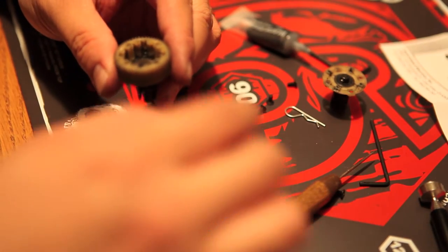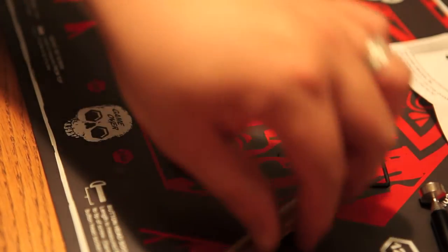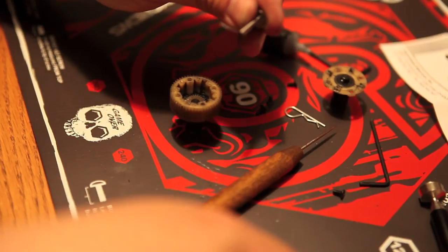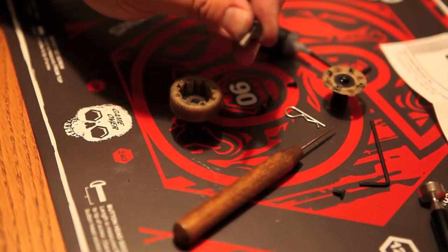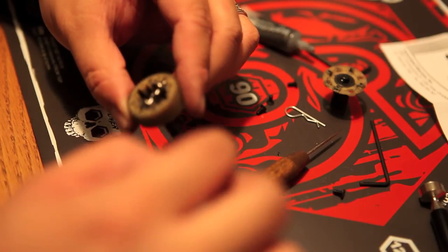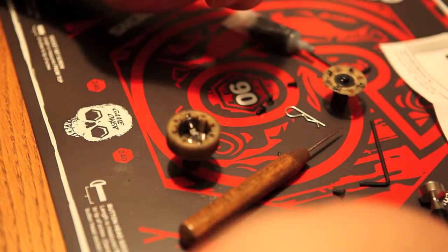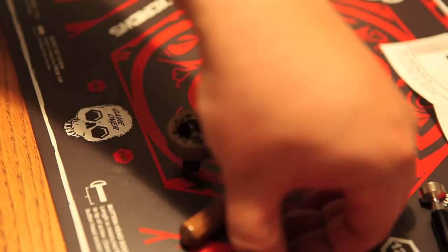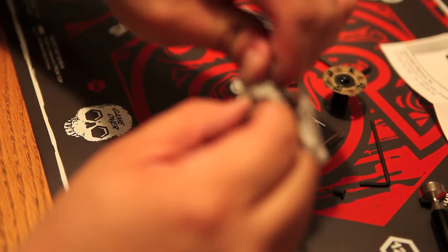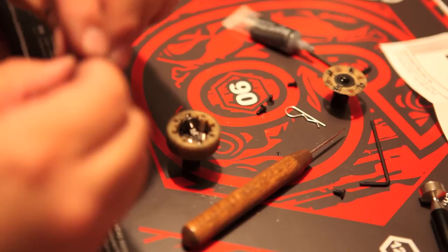Just doing an additional cleaning to make sure the old grease is out. Now I'm assembling the cross pin with what Team Associated calls the planet gear — I tend to call it the planetary gear from an old Tamiya kit. You just get the cross pins lined up and assemble the four planet gears on there, which can be a little tricky to line up.